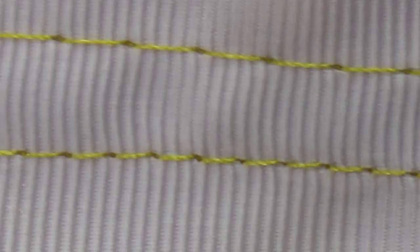That's an indication that our upper tension might be pulling a little bit too hard. So this is again where, when you get into the lighter materials, the 100% polyester, the 100% cottons and the silks, the satins, you might need to back off that upper tension more than you normally would. You still have a beautiful stitch, both the top row and the bottom row, but as it starts to pull too hard, it actually elongates that space between the stitches and makes that hole a little bit more pronounced. That's an indication the upper tension needs to be backed off, just a little bit. But we are on a solid page 34, without a doubt.